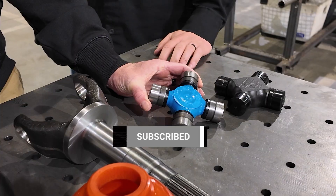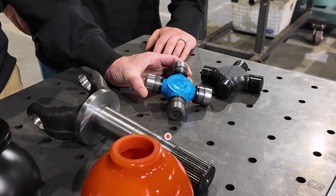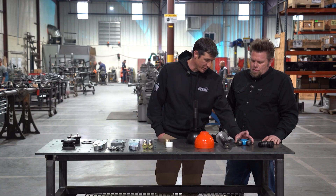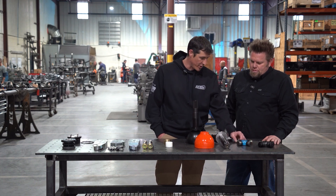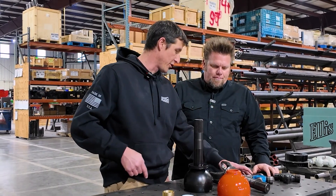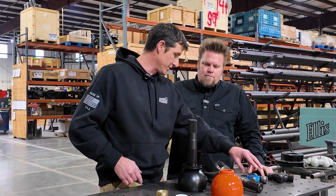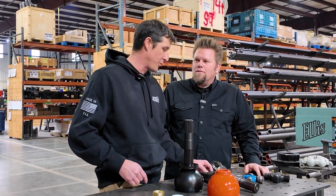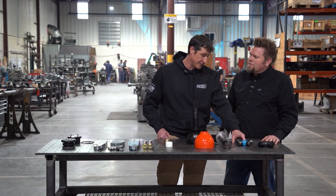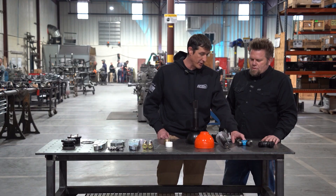So we talked about it's 1550, which this is a 1550 U-joint. This is the Spicer Life — we call it the Blue Joint. It's a forged cross U-joint, and it's not cross-drilled all the way through. When you get a greasable joint, there are holes drilled all the way through it, which obviously weakens it. So this is Dana's heavy duty option — a great joint, and they've held up really well.